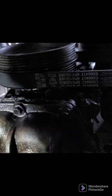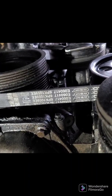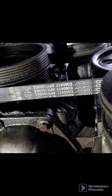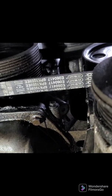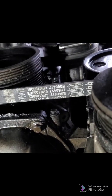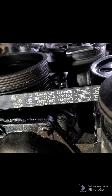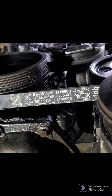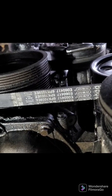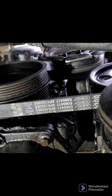That's it — got to put the secondary belt on now for the air con side and we're golden. Thanks very much for watching and I hope that's been of some use to somebody struggling with these horrible stretch belts. I believe Ford have gone back away from them now — they were a way of cost-minimizing, getting rid of the tensioner, and they are absolutely awful. But you can do it — you just need a little bit of patience and think outside the box.